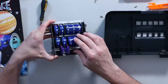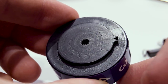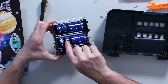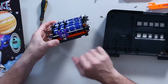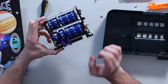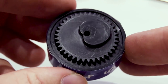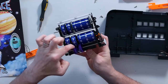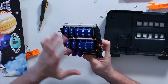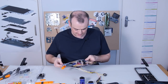It comes off as a module. On the end of this cylinder there are just two teeth, next to what would be the relative position for zero, zero, zero. As you progress this round, those two teeth eventually bite on this purple gear and progress the next one — and there are two teeth there to progress the next one after that. You've got these two little nylon detents at the bottom just to make sure it stops in the right place. On the end of this shaft, if I spin that round, you can sort of see there's a cam shape here. That cam is biased, so when we push the reset and lift the teeth clear at the bottom, it's actually the cams that push it all back to zero. Depending on the shape and design of the cam, it doesn't matter where you are — it's always going to push to that flat side on zero, zero, zero.